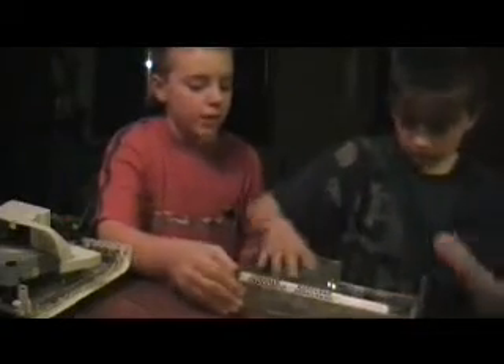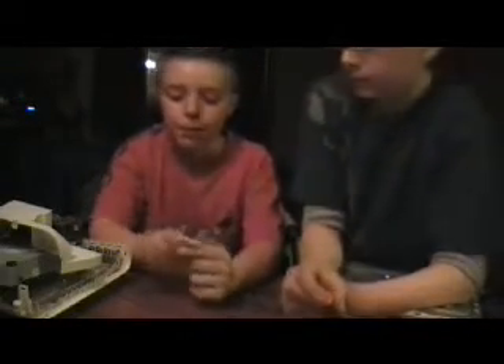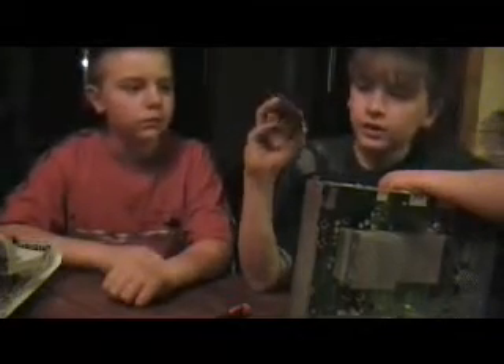Next part is removing the actual front of the board. You have to take it forward. This is the front of the Xbox you see when you turn it on — it's got a green light. This is your Torx 8, which is what you need to pop this off. Just pop that off. This is just the front, so your Xbox's lights show up. Some modders actually replace these plastics with a clear color of their choice. We'll be taking the front of the Xbox off, and there's this little chip up here. You've got to take the two or three screws out with the Torx 8. There's a little chip that connects to your motherboard.